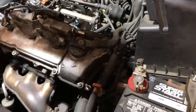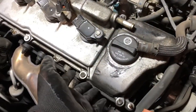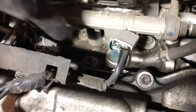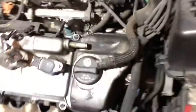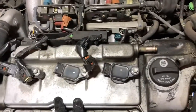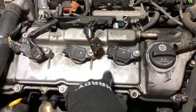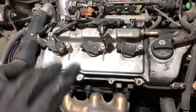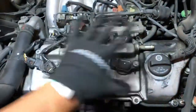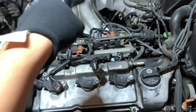The customer says there's an oil leak coming from somewhere in this engine. It looks like it's most likely coming from here — there's a lot of wet stuff in there. I'm going to be replacing this valve cover gasket, but I'm still considering whether I need to change the other one. Once I take the manifold out I'll check it, but the culprit is most likely here. I'll just check to make sure if the other one is still okay or not.